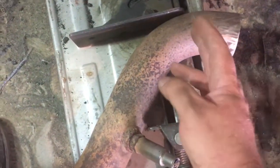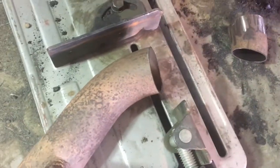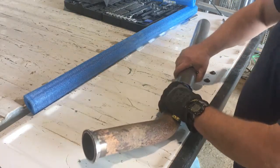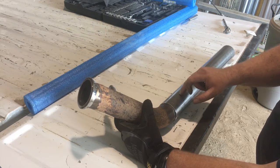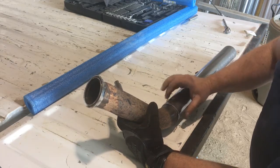This is that little piece of factory exhaust pipe. I've just got to cut it right here, because the angle my manifold comes down at is different — it's kind of pointing up into the frame of the truck — so I'm just going to cut it there and square it off. Now I'm going to cut a straight piece of two-and-a-half-inch exhaust pipe to make up the main part of the crossover pipe I'm making. I'm going to use a trick I learned on another YouTube channel — using a piece of foam pool noodle — it actually works really good for holding your pipes together while you're fitting stuff up to test fit the exhaust. This two-and-a-half-inch exhaust pipe is just slightly bigger in diameter than the factory piece, but I think I should be able to make up the difference with the weld.